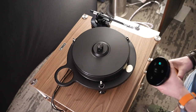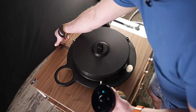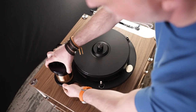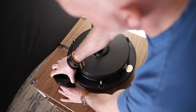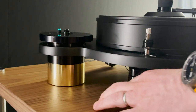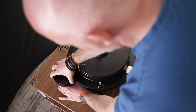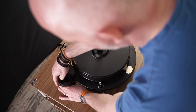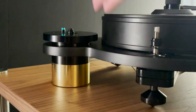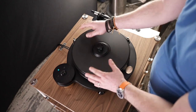We're now ready to put the motor and power supply in position. Move the tone arm wires around the back of the turntable. The best location for the motor switch is pointing at 12 o'clock where the turntable sits. Make sure the turntable is in the position you want it on the rack, then position the motor so that the outside circumference matches that part of the chassis. At this point we need to level the rest of the turntable and set the suspension up, then put the drive belt on and we're pretty much there.